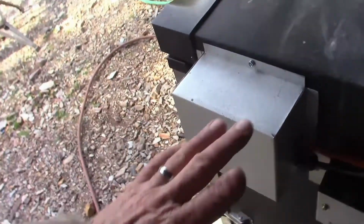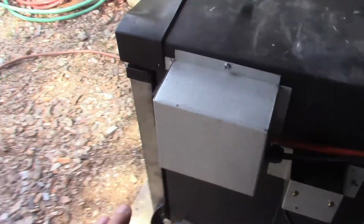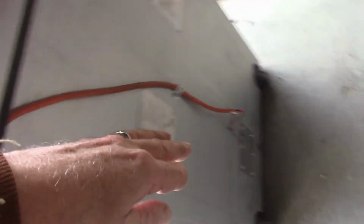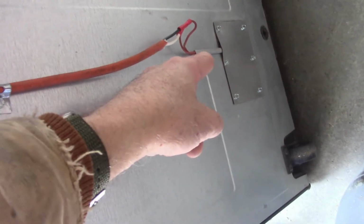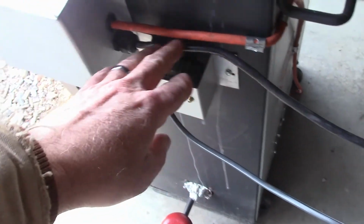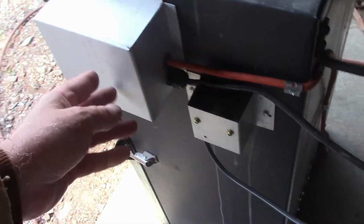So this is the wiring we were talking about. The relay is in here, and the controller is in here, and then this orange wire goes back here to, I've still got to get this covered, and that goes straight into the element. These two wires do. You do want to be sure when you wire that up, you use some heat resistant wire for that. And then this is the power coming in, and it just powers the relay and powers that control module.